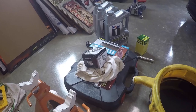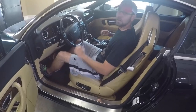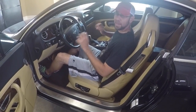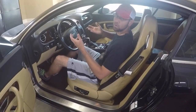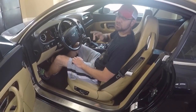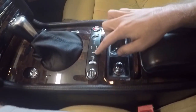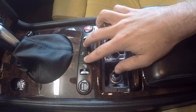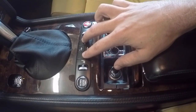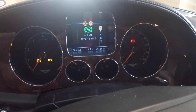Let's start with some things you might not know you need to do on a Bentley to do an oil change. Before we can actually do anything with the oil change, we need to put the Bentley into jack mode. This will allow us to jack the car up without hurting any of the suspension. You have to hold these two buttons down — the one with the car height and the one with the spring — for about 10 seconds. And now you can see in the dash, right there, we have it in jack mode.